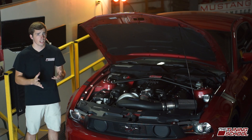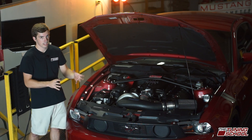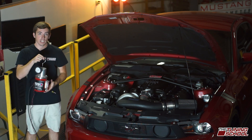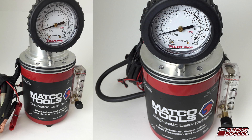For those of you that have never smoked a car before or have never seen one smoked, I'm just going to go through a real quick setup on typically how it's done and how it works with our machine. So this is our smoke machine right here. All it does is it burns oil to create smoke. You have to connect it to an air source and then it connects to your battery, so typically you can just hang it right here.